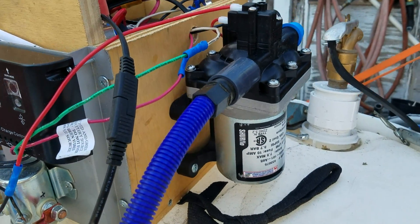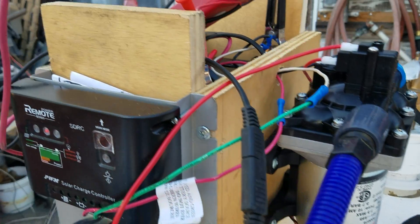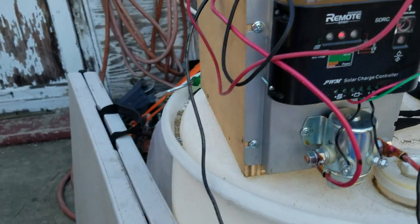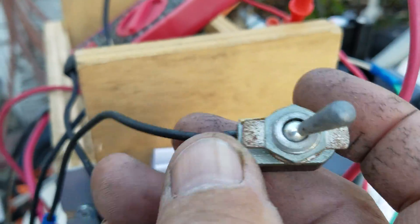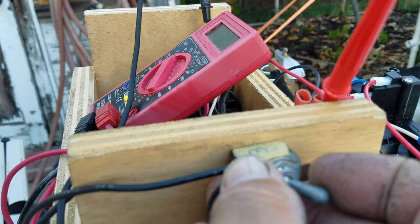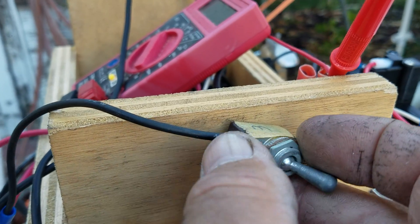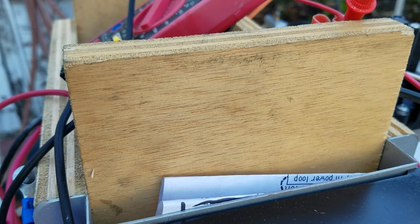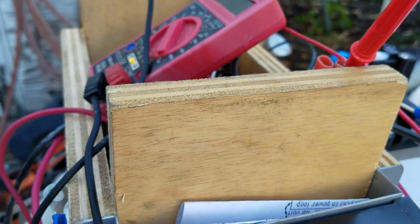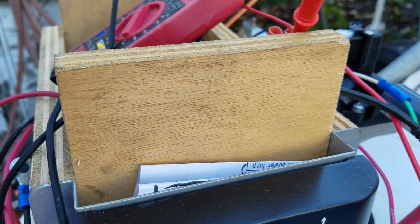I have this T unit which will connect right in between there, and then this line coming off of here will connect to this pump right here. This is a 12-volt pressure-activated pump, and that's also connected to the battery. It has a switch on it, and I haven't tied the switch in completely yet, but it will mount on the box here. So when you want water pressure, you flip the switch on, the pump will run, come up to pressure. As long as all the faucets are closed, it'll stop. When you open a faucet, the pump will turn on and keep your pressure up.